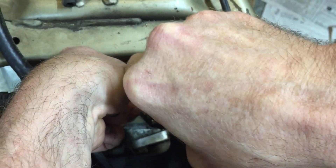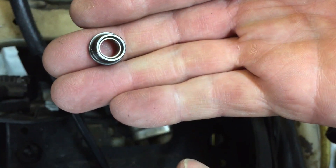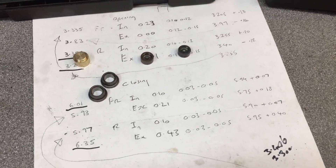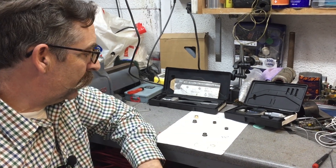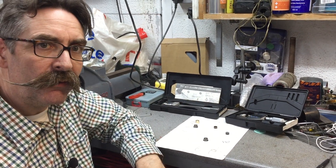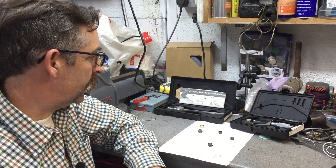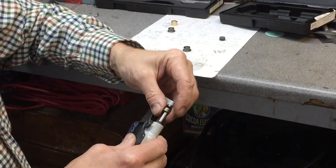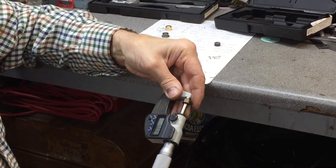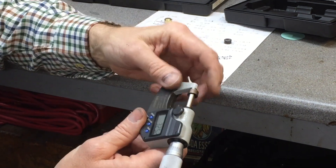Once you've got all your collets and all your measurements of your valve clearances, it's over to the bench to do a bit of measuring of your shims. So we've measured our opening and closing clearances on the engine and we've got our shims out. What we need to do now is measure the shims and then work out what clearances we need and whether we need new shims or we can swap some shims around to get the job done. For the openers I've been using a micrometer to measure the thickness of them — you measure from inside where the valve sits to the top.